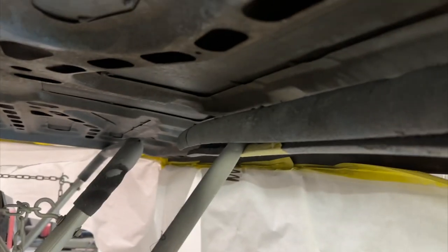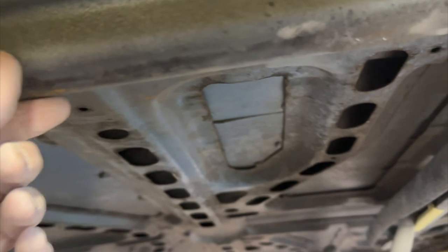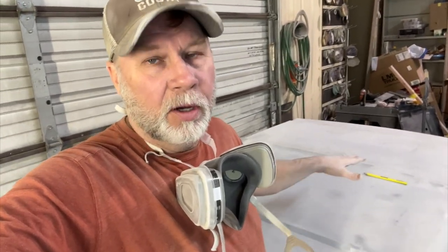Another thing, you notice this hood is not touching the stand in the middle. It's only supported on the edges, on this main piece of metal on each side. You can do it side to side, as long as there's plenty of support, or front to rear. But you don't want to set the hood on one stand and have it pressing up in the middle of this hood, because that's not how it sets on the truck. So if you just use one stand, hood is setting on that one stand in the middle of the hood. That's not how it sets on the vehicle. On the vehicle, it's supported by the main frame of the hood, right? So if you set this thing on a stand that's pushing that metal up, you block over it, you put it on the truck, you're gonna have some waves and stuff to deal with. So it needs to set either on the vehicle or like it sets on the vehicle on the stands.